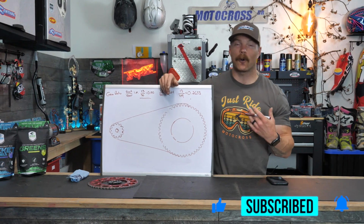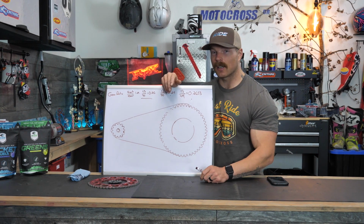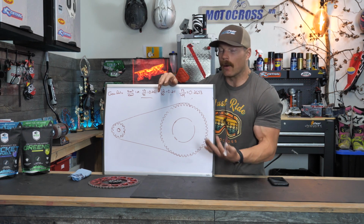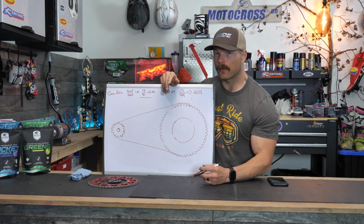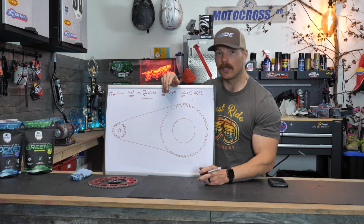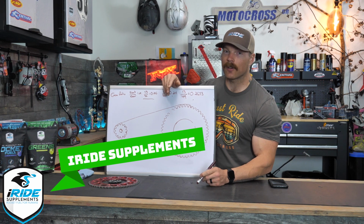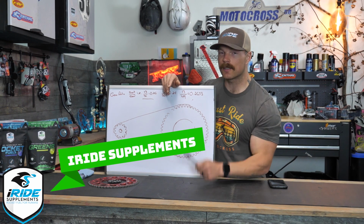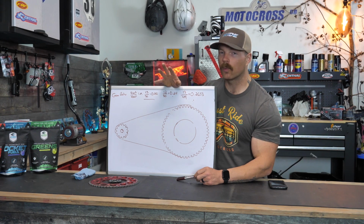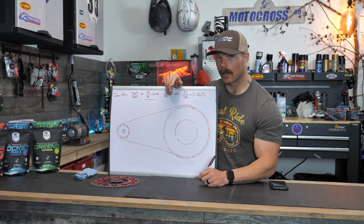Look, I hope the video helped clear some stuff up, tried to explain why this gearing stuff changes things on the bike and whether or not maybe you want to add some speed or some power to your bike and how that's going to be affected by all this stuff. So when you go to order the sprocket and they ask, well, how many teeth do you want? And let's say the stock is 49 teeth. Now you'll actually have a more intelligent and more informed decision to say, I want to go up one tooth, or I want to go down one tooth, or whatever the case may be that you need to get out of your bike. But hope that helped clear it up a little bit.